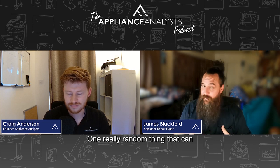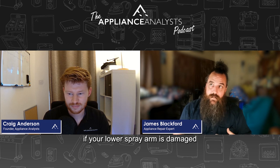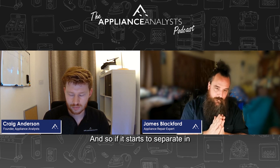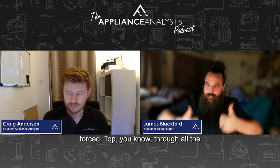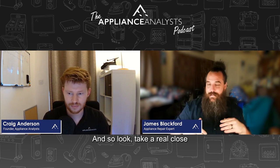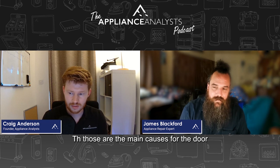One really random thing that can cause it to drip out the front is if your lower spray arm is damaged or cracked, because it's typically two pieces of plastic in the factory that they put together. And so if it starts to separate in the middle, instead of the water being forced through all the holes, it's going to be forced straight out, and it's going to hit the door and leak out. So take a real close look at your lower spray arm too. Now, those are the main causes for the door drip.